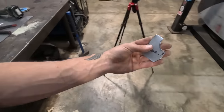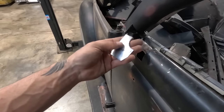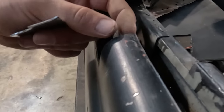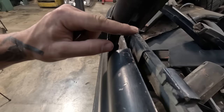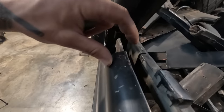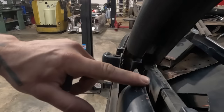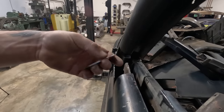What I have for an idea for the hammer form now is I think I'm gonna use a piece of plate on the back side and then also a piece of plywood to make up the thickness. And I think this will be advantageous because I'll grind the plywood for the radius and then I'll have maybe a quarter inch piece of plate on the back side of the ground lower hammer form that will be a solid edge that has this radius in it where I'll be able to actually hammer the last little lip, because this actually ends with about a 3/8 thick sheet metal lip that goes up into the window channel. So if I want to recreate that and actually finish this bend over, having a steel backer to that hammer form, I think will be awesome.